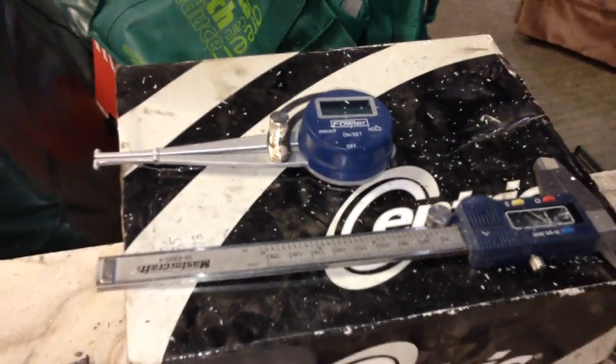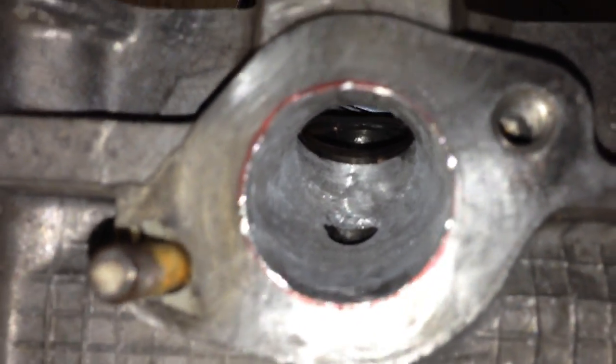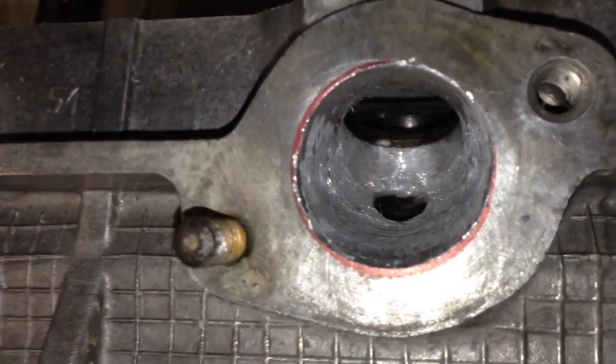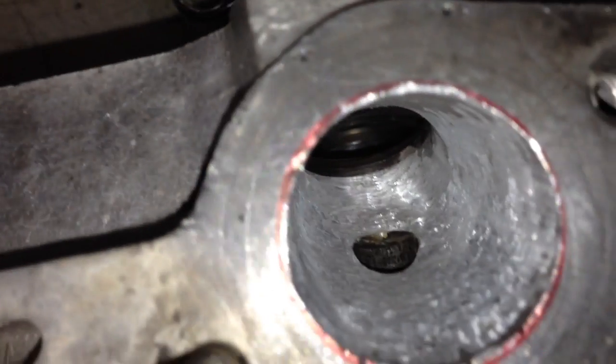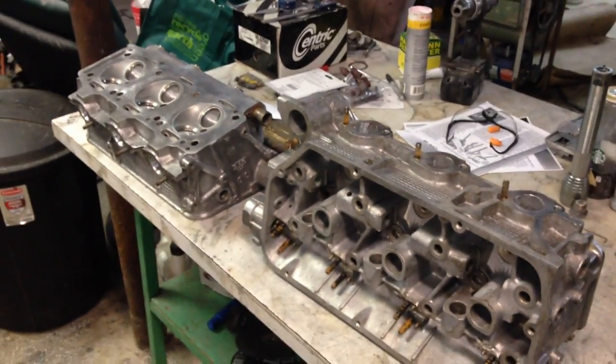At this point on the exhaust I should take some more measurements with my calipers, make sure that it's within the specs that I have, and then start with the sanding type abrasives to get a nicer finish. Then maybe finish it off with a little bit of finer sandpaper, or maybe some buffs, to get a little bit more shine on that port so crud doesn't build up in them. Maybe I'll do a video when I'm finished to have a look at what the ports look like.